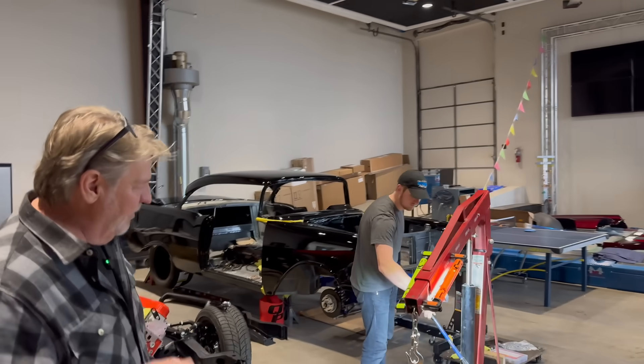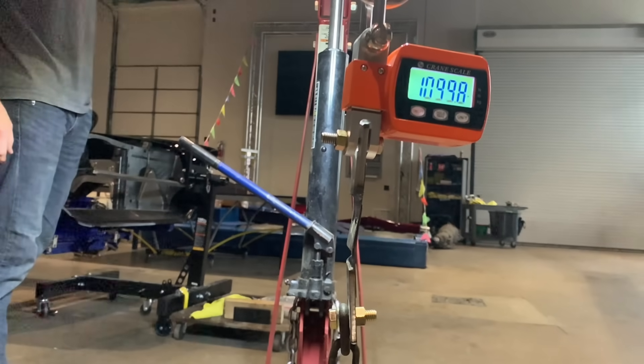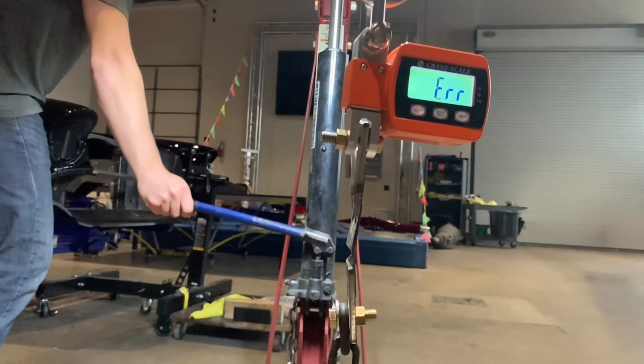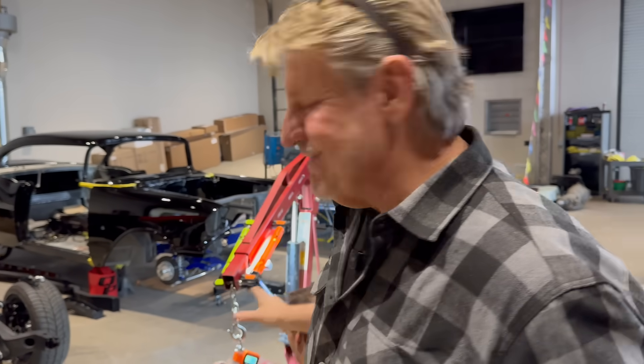Two plug welds on the bigger gauge. We're at 500... 750 — this is where the other one broke. Don't look at it Kyle. 1000 pounds — hold there for a second. I guessed 1100, I'm definitely not wrong yet. A little more... that's all she's got. That's the max — 1100 pounds. We know how to do some plug welding now! Think about that — you could literally lift two big engine blocks with that. We're going to put the big strain gauge on the panel bond now.